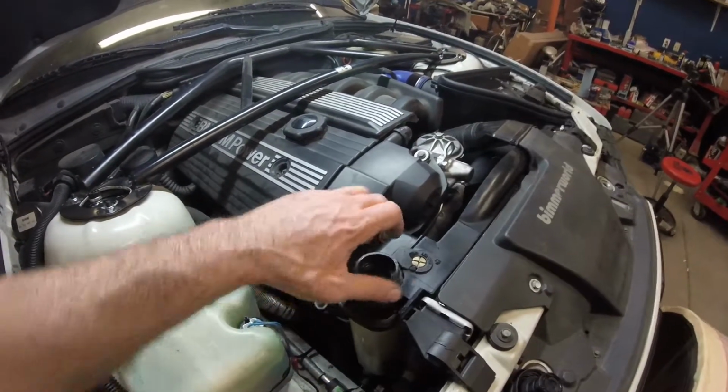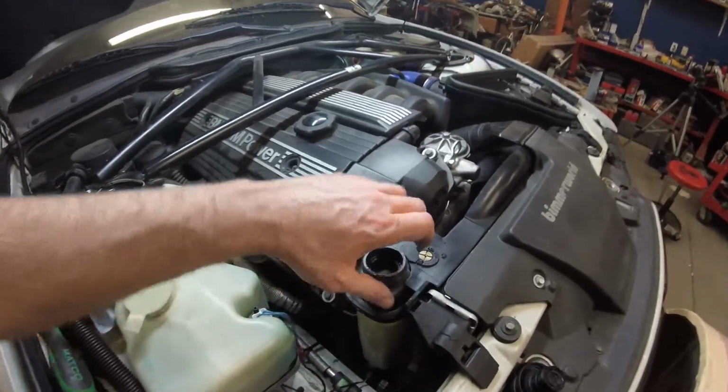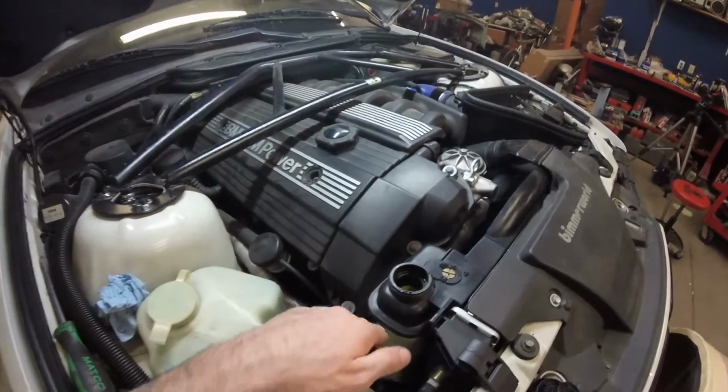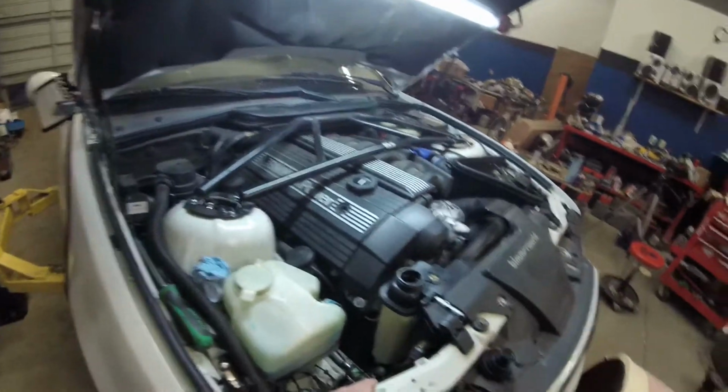So I had to slowly open it and close it, open it and close it, to the point it stopped. And then when I opened it, it just sucked the coolant straight down and finally bled the huge air pocket it had in there. And it's after midnight now, and I'm wore out, so I'm not gonna do any more tonight. I'm gonna take the time tomorrow and go through it and finish it all. You guys will be along for the ride.